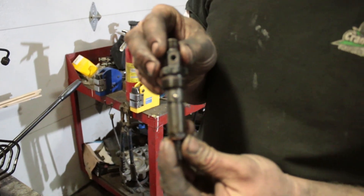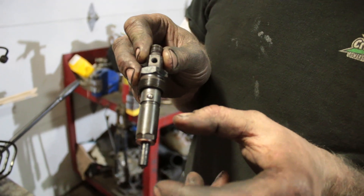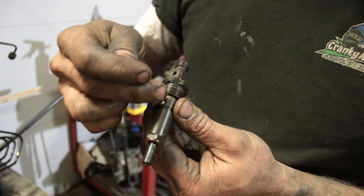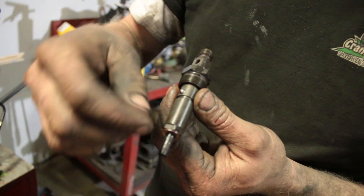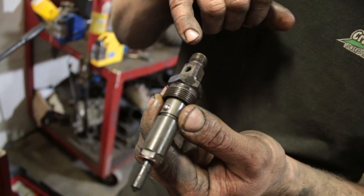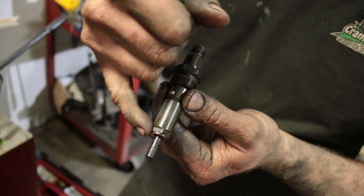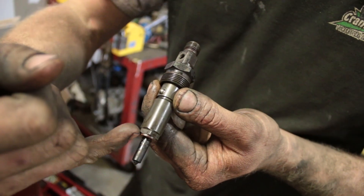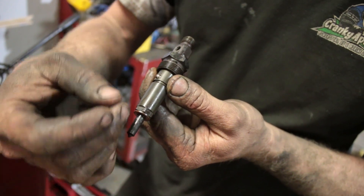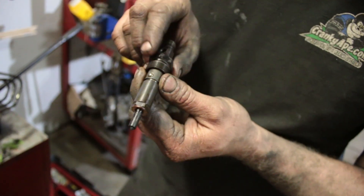This is a serviceable injector — you can replace the tips. There are two parts to it. The tip is at the bottom; if it gets damaged at all, you have to replace it. Inside is a giant spring that pushes on the injector tip with a couple thou clearance for fuel to run around the outside body. As the injection pump applies pressure to the fuel, the fuel leaks to the side of the injector tip and pushes against the spring, unseating the tip from the body. As it does, it sprays the fuel out, and because that pressure is gone, the spring seats it again almost instantly.